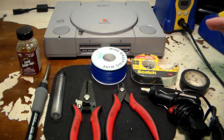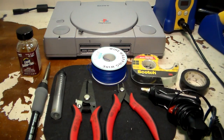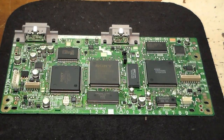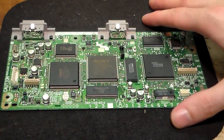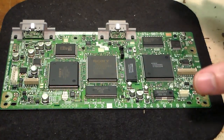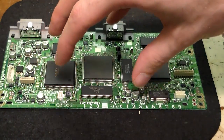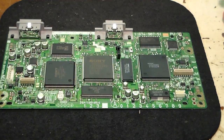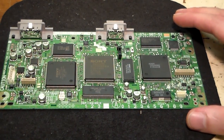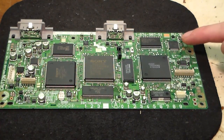Of course, you'll also need your mod chip. It's a pretty basic installation — not a lot of tools required. Installing a chip in the PS1 isn't very difficult; I'd say it's pretty low difficulty. So let's take the motherboard out and install the chip. Here's the motherboard out of the case — it's pretty small because this is a 9000 model. If you're chipping an older model like 5500 or 7000, your motherboard is probably going to be bigger. Some motherboards also have shielding soldered on top, so depending on your model you might have to remove that first.